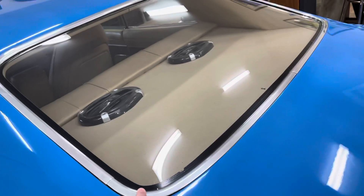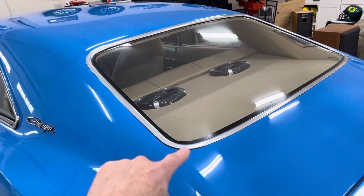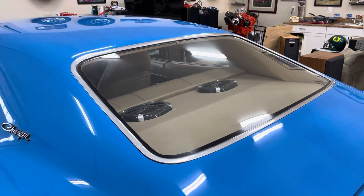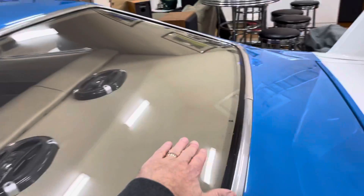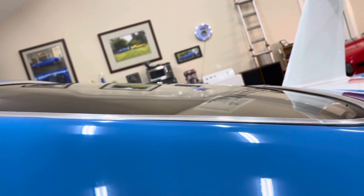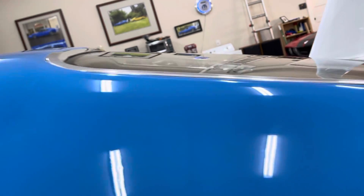It fits in there and you don't have to worry about modifying your trim. With a Daytona rear plug you've got to modify your trim and come up with solutions. The glass for a Daytona rear window is very hard to come by, even aftermarket. There are plastic ones available, but I've seen plastic ones where the heat of the sun gets so hot it can lose its radius. The original Daytona windows have kind of a bulge to them — they're not flat across, they have a radius and a bulge, and that's hard to come by.